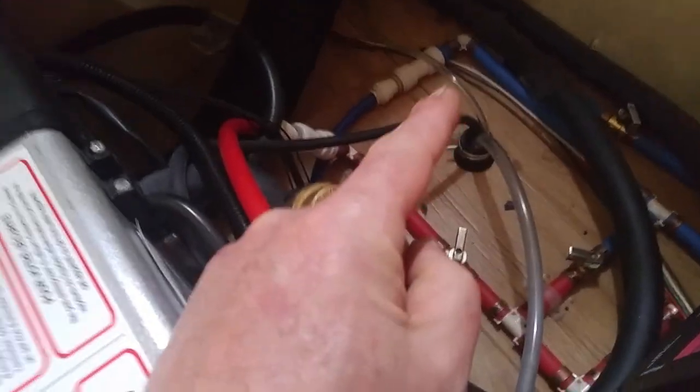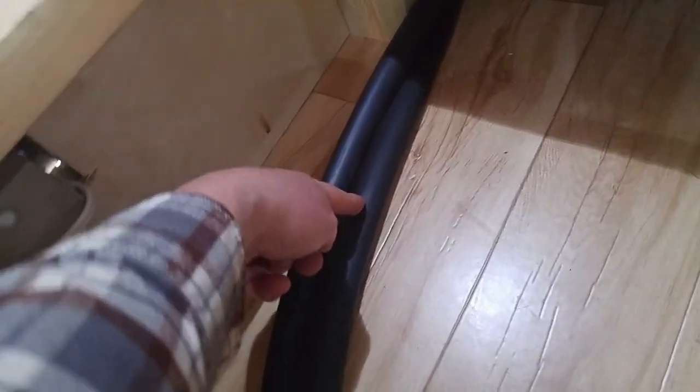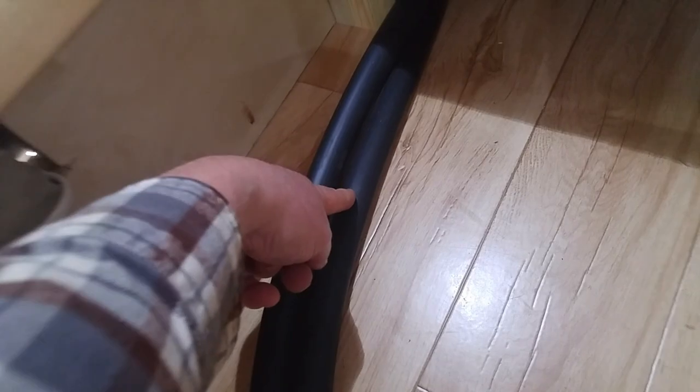Neither of these low spots is tied to this drain. So this is what I'm going to do — it's a little radical but I'm up for it. This pipe right here is the output of that radiator, and on the passenger side of my trailer this is the absolute lowest spot — it's below all the radiators in the system. So I'm going to cut that pipe, put a T in, drill a hole down to the bottom of my trailer, and put another drain there.